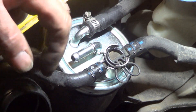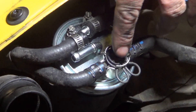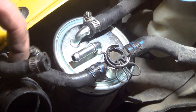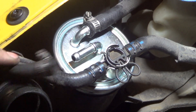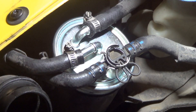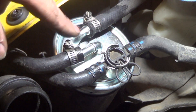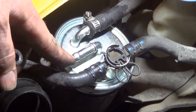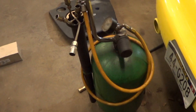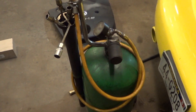There are lots of different ways you can prime this. One method for a do-it-yourselfer might be to leave this out and simply pour diesel fuel in there. But the method that I use is to hook vacuum to here, and it draws fuel from the tank through the supply line. Once fuel starts coming out this hose, you know the fuel filter's full. This is the equipment I use to prime a fuel filter, or prime an injection pump for that matter.